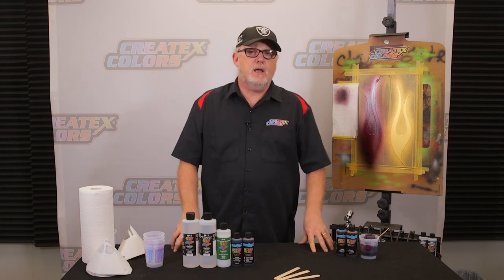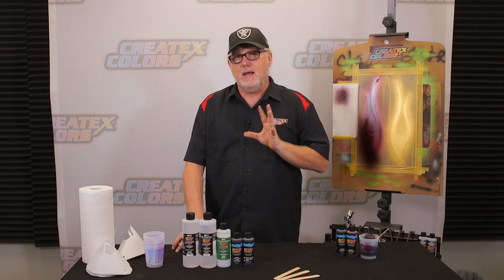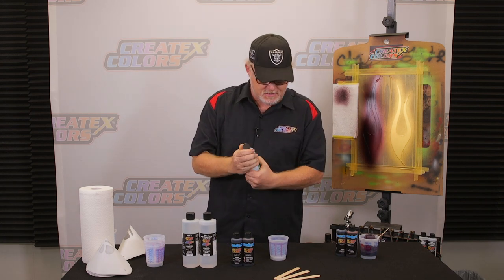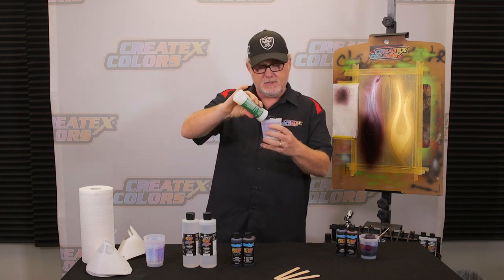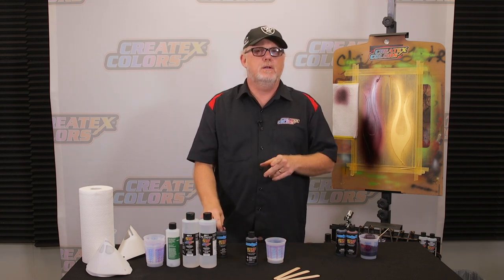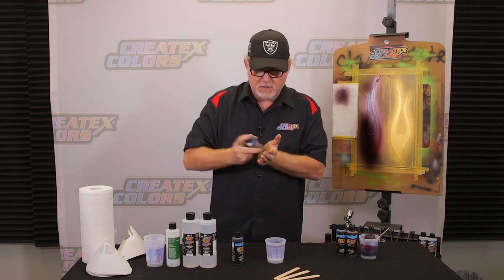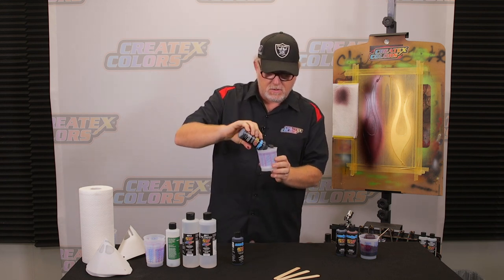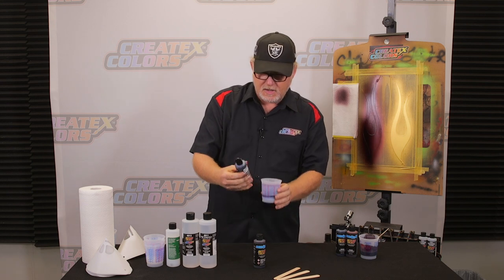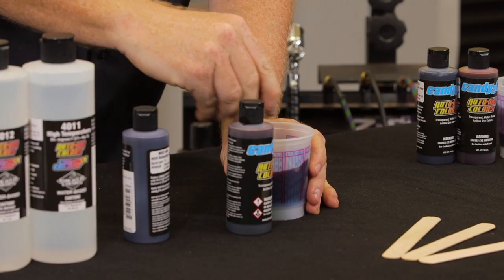Okay, got the gun good and cleaned out, and we're gonna go mix up that secondary color. Remember, the second one didn't have any candy black in it. It was a combination of Brandywine and Deep Purple Candy 2.0. So we're gonna start out, same cup, same 40-30, same shake. And I'm just gonna put a little bit, like I said, same thing as before, a little bit less than an ounce in there, not much. And it is a 2-to-1 Brandywine to Deep Purple. So that basically means that'll be easy for me. The Brandywine in there, and then come in and put approximately half of that, the Deep Purple. And give it a good stir.